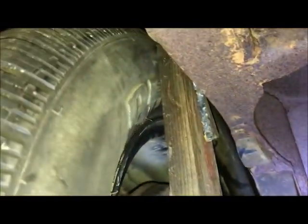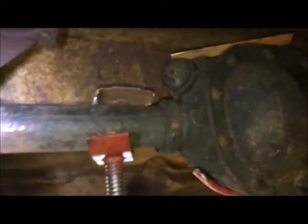I have my shims, some wood and some metal on both sides. So that tells me I have about 1.25 inches on the inside, and at least 1.5 inches on the outside. It looks real good. Lots of room on both sides. And again, this is with those high offset wheels.